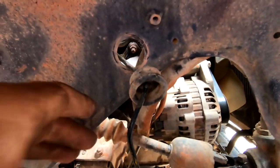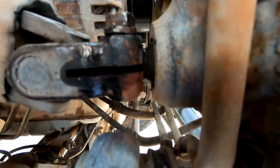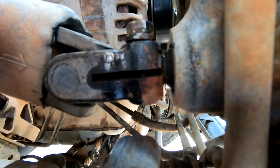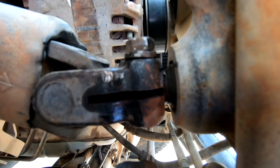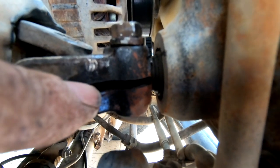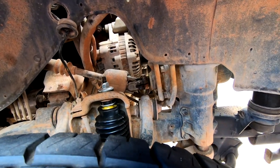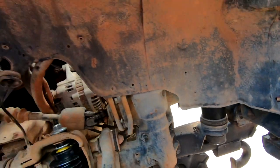Just to finish up, I'm going to straighten these up and pop the rubber back in. I'm going to tighten the steering column shaft up — I put a screwdriver in there to open it up because it was stuck solid with dirt. It's probably moved back about two mil, so I reckon you don't need to do that. With a two inch body lift it's probably moved two mil — definitely not needed on one inch, two inch I'll leave that up to you. We'll sort the brake lines, tighten all these nuts up, and then we'll call that it for this video.